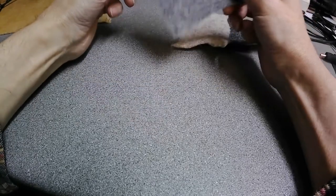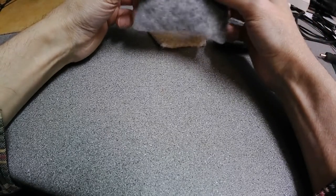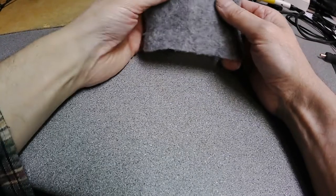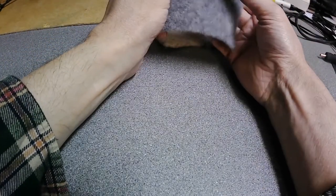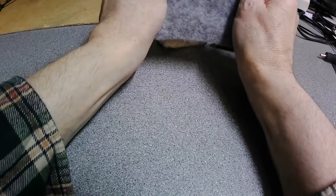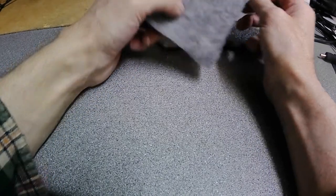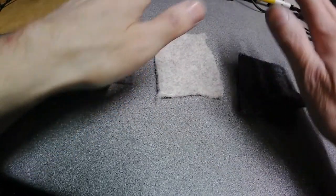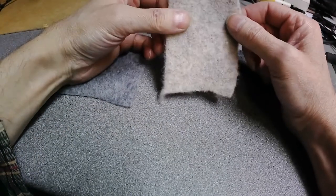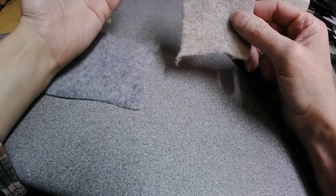But with this cheapest one, and sometimes it's not the cheapest, sometimes they sell it with other prices, if we carpet something, all imperfections of the surface will be visible. Maybe not on a totally flat surface, but they will be visible. So for me, the most important thing when buying carpet is asking the seller about the weight of the carpet. I think the minimum is 350, 370 per square meter for a carpet to be useful.